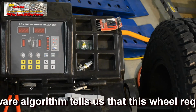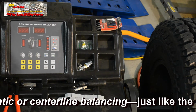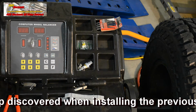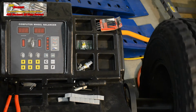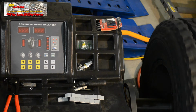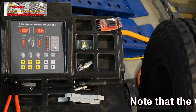So after experiencing that weight phenomenon of balancing the tire, running it a second time and finding that it needed even more weight, we removed the weights and we're going to examine this tire under different modes of balance. So let's spin up the tire with no weights on it. The weights have been removed, all adhesive cleared. Sometimes it's necessary or worth trying a relocation of a tire on the rim if the weight is excessive. We're going to take several readouts on this.